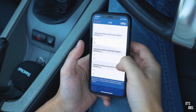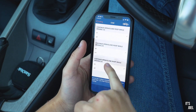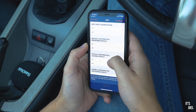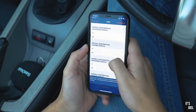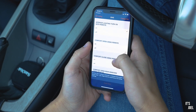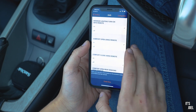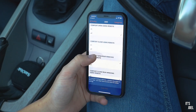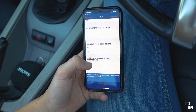Continue — open/closed roof while driving, on. So I've got them on. Interesting, I wonder what else there is. Let me go back out of there — let's go into locking and comfort functions. Read out GM5, let's do another backup. Backup created. So we've got anti-theft on, optional confirmation of unlocking the vehicle on, audible confirmation unlock. There are all of these options — I'm not going to go through them all now because again we'll be here all day. Comfort open using remote — press and hold the unlock button to remote open all windows and the sunroof. I wonder if that means I can open my roof with the key. So let's see if I can do that. Comfort open using remote: on. Comfort close using remote: on. Code now.